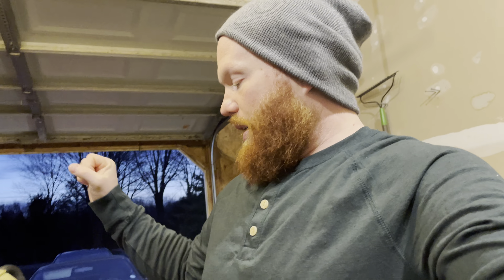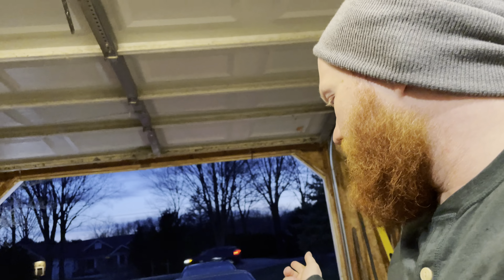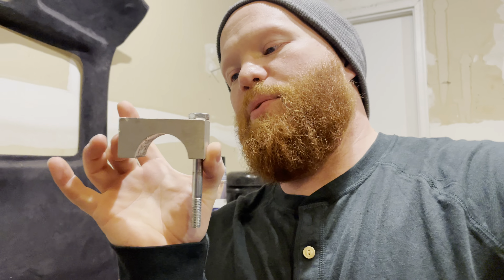This engine actually was already in an S13, but it came with these nasty log manifolds — so these guys, I am not going to be running any of those. I don't like the sound of V8s without equal length manifolds on them. I'm actually waiting to hear back from Burns Stainless with their X-Design exhaust program to see what they say the headers should look like as far as diameter and length, and then we're going to try to build those as close as possible to those specs so we can hopefully get some extra output out of this engine.